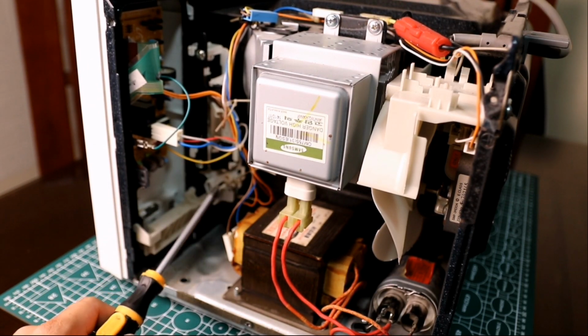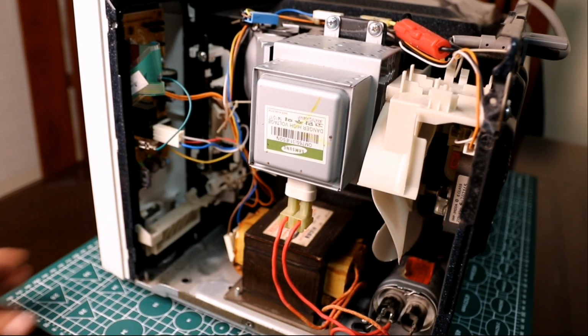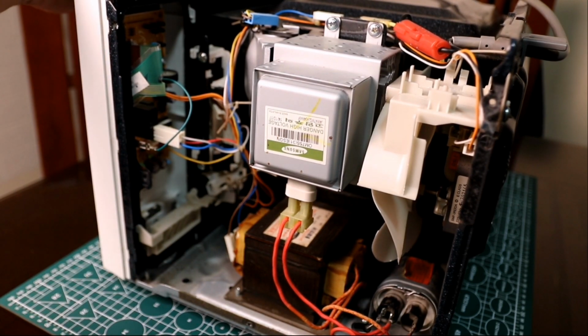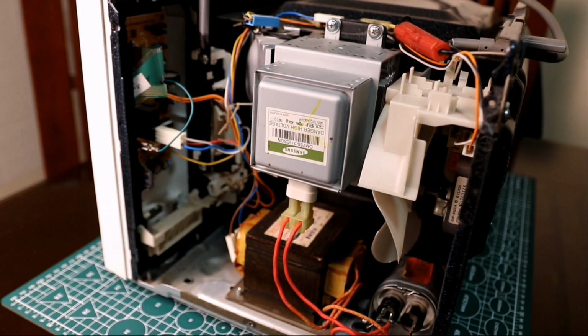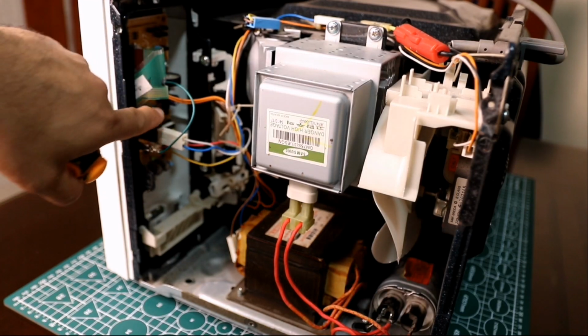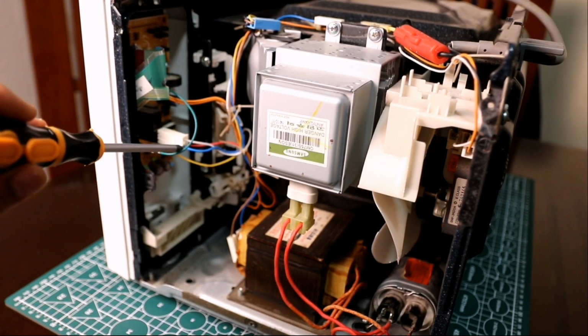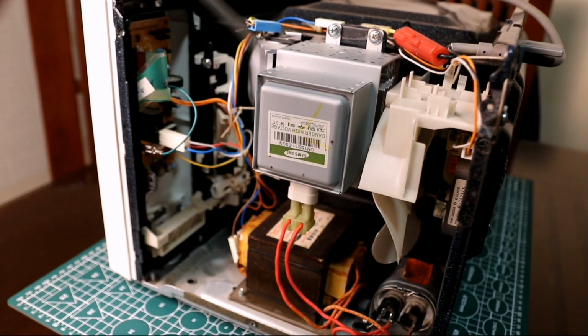The main circuitry is designed to be activated when the door of the microwave oven is closed, and deactivate when open. The door's push to open mechanism is coupled to some switches so that the system knows if the door is open or closed. That way, we can ensure the magnetron will have no way to be energized if the door is open. This is the timer controller circuit and flex ribbon for capacitive touch switches.